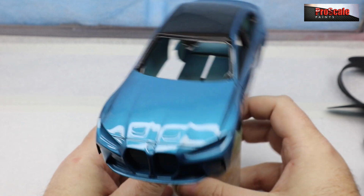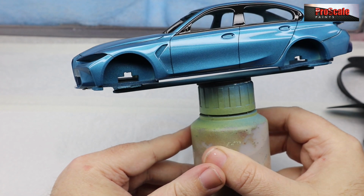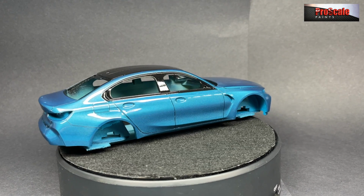Now, I know a lot of criticism of 2K is it's too thick. This is a nice thin finish. Once this is flatted back with some Trizact pads and polished up with the UMP polishing system, this will look fantastic. It'll really look nice and shiny. You'll get rid of all those dust spots and it'll lose any imperfections left behind.